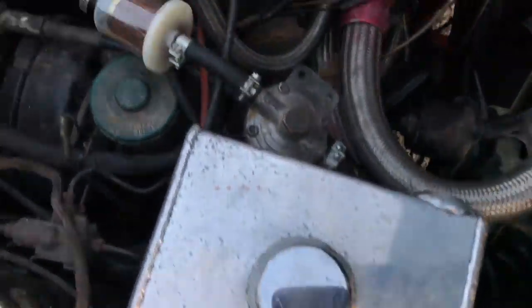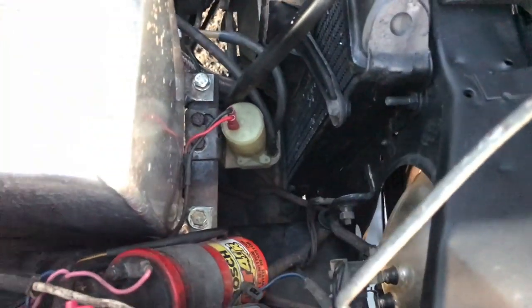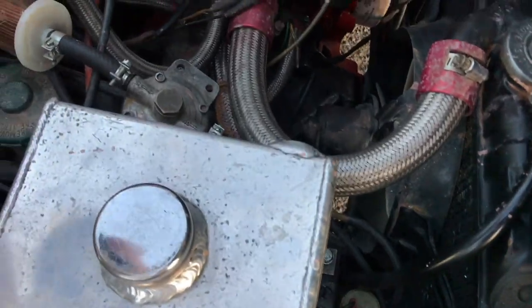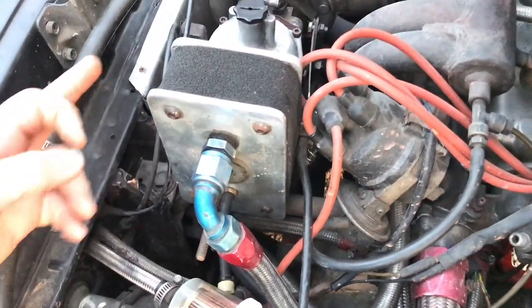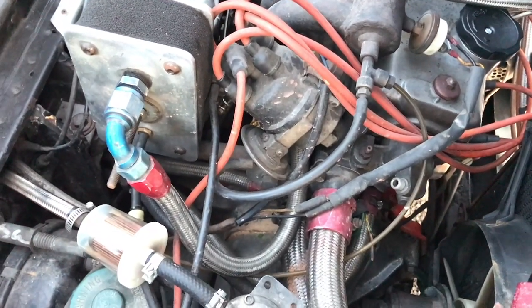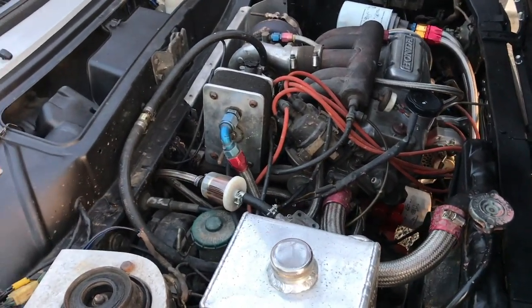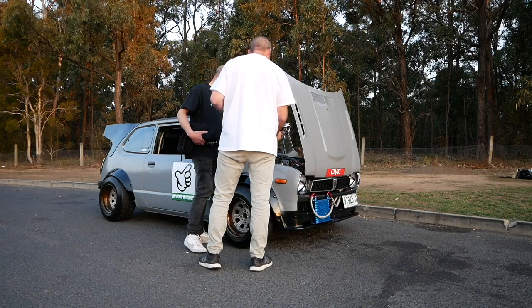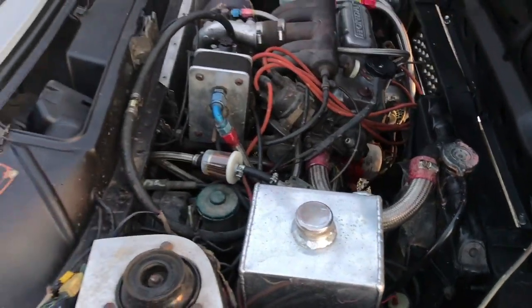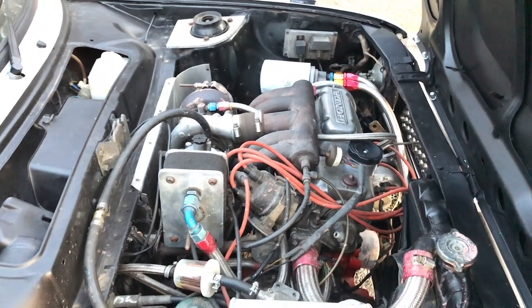Looking at the reservoirs here — there's a little pump — there's the fuel pump, and there's the meth pump. It just goes into the air filter, straight into the carb. It's got a real restricting jet as well — the actual spray that goes in there is like a tiny pinhole of water and meth. It's triggered at boost level — same deal, 5 psi like the last one — then it sends an electrical signal to the pump and just starts pumping. Nothing like that worked when I bought the car. I had to get it all going again, test everything, make sure it was all working. But yeah, it's all good.